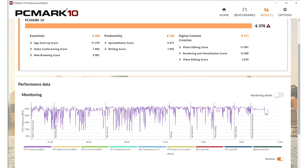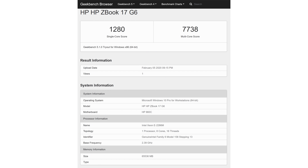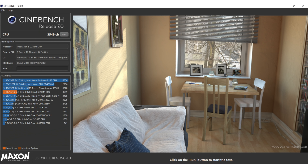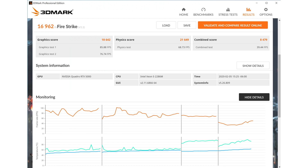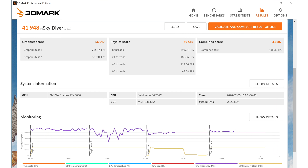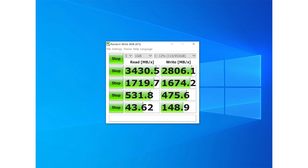In terms of performance and cooling, HP says it's 20% improved thermals from the previous generation. We have the Intel Xeon model with the NVIDIA Quadro RTX 5000, which in consumer terms is closest to the RTX 2080 — except this one has 16 gigabytes of GDDR6 VRAM versus 8 in the consumer card. I was impressed not only by the benchmark numbers and rendering speed in Blender and SPECviewperf tests — which usually take forever but ran so fast on this — but also the thermals. CPU core temperatures rarely break 90°C, rarely exceeding 95°C. Fan noise is not annoying or egregious. It's well cooled.